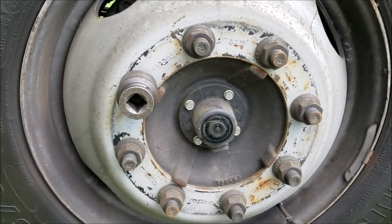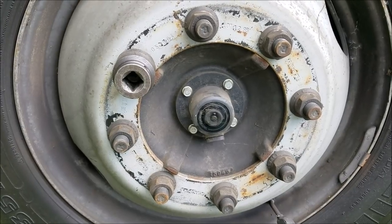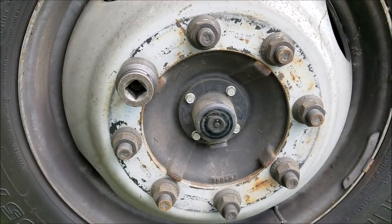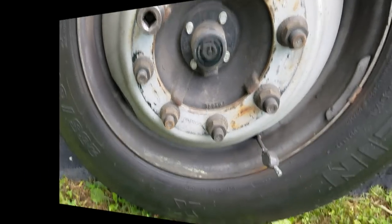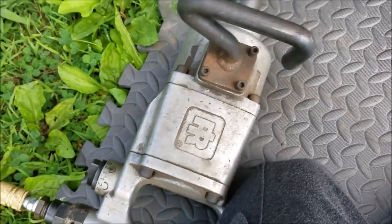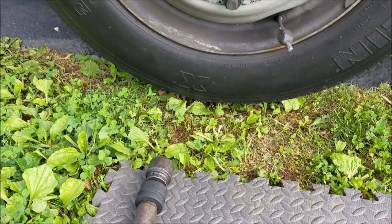I've had my wheels off before rotating them. I do have a big impact I'm going to drag out to get them loose. Even after I get them loose and put them back on with an impact, I'm not sure I'm getting them back up to 475. So what I do — I go to a local tire shop about two miles down the road and borrow their five-foot-long torque wrench. I go out and check my torque on the nuts myself. I think most tire stores wouldn't mind that if you know somebody. Because you want to make sure you get them back to 475 for sure. You don't need anything like this; a friend gave this to me — it's good to have friends. You could go to Harbor Freight, get a big socket and long breaker bar, and get them off yourself. No problem. Let's get to work.